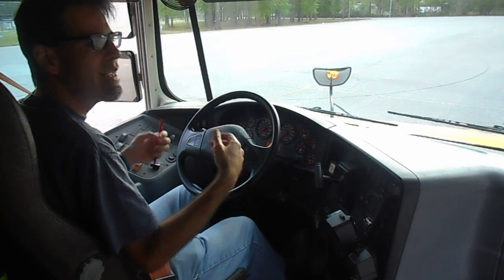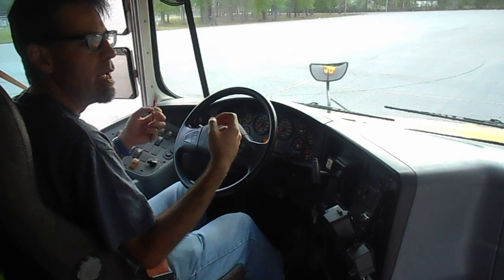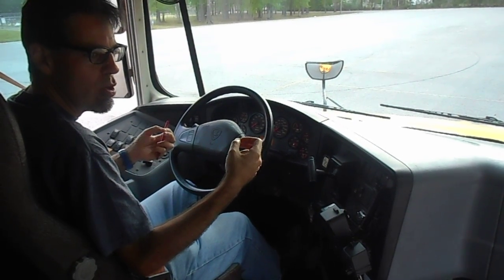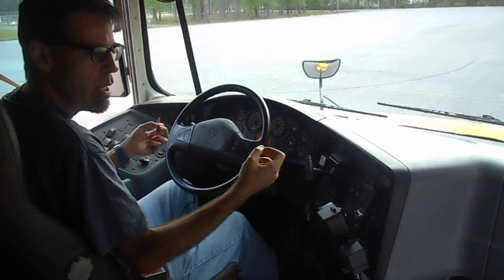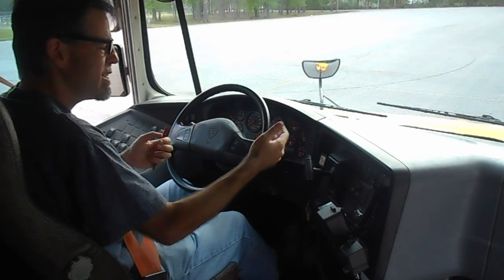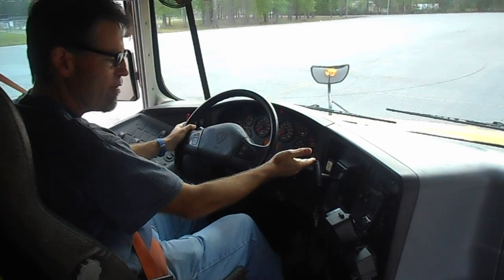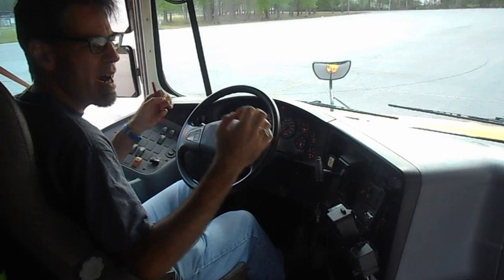At this point, I will keep fanning the brake. This is called the spring brake part of the test, until the air pressure reaches between 20 and 40 psi, or any other level that is specified by the manufacturer. And at that point, that yellow diamond, the parking brake, will pop out just like a spring. So that's what I will do right now. Sure enough, the parking brake popped out like a spring. So this completes my air brake test.